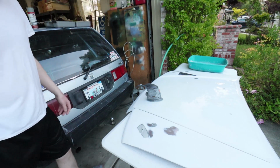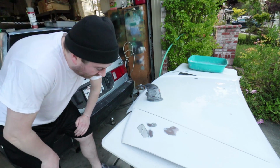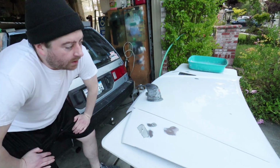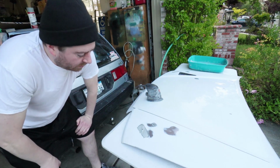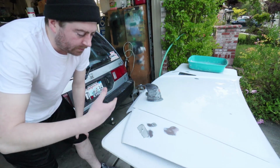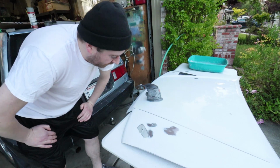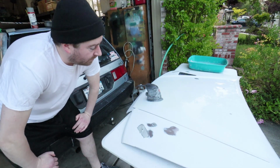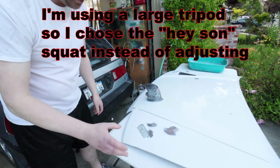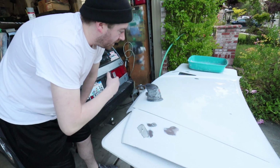Alright, so I just got back from checking out that Cadillac. I could probably fix it, but it would take me way longer than a shop to do it because I don't have a lift. I thought it was something straightforward, right there on the serpentine belt, but it's down below. It's a front wheel drive car, so it doesn't have the serpentine belt in the very front. It has it off to the side because of the placement of the motor. It has to compensate for the transmission being front wheel drive, I think. I know a lot of other GM cars have the water pump right in the front, so I was hopeful it would be that scenario, but it's not. And I referred him to a trustworthy shop, and we'll see what happens after that.